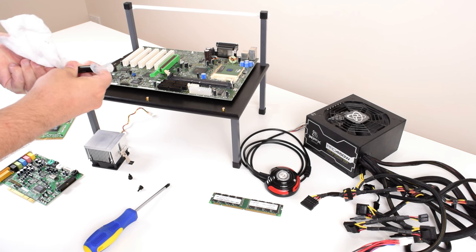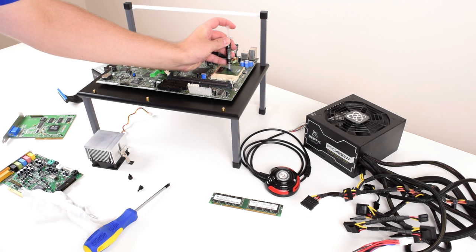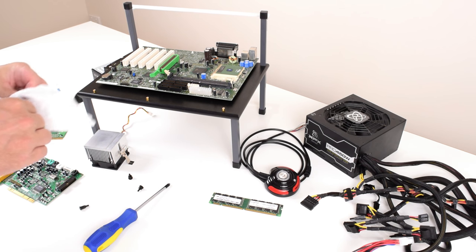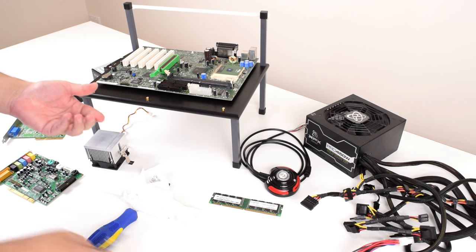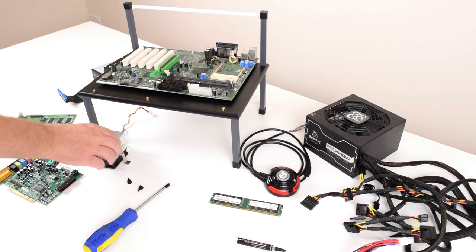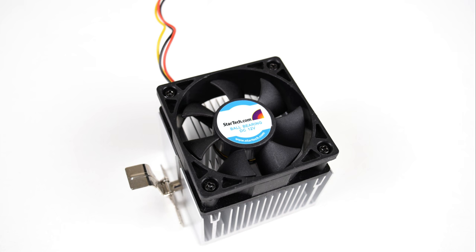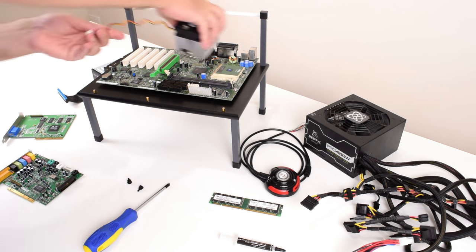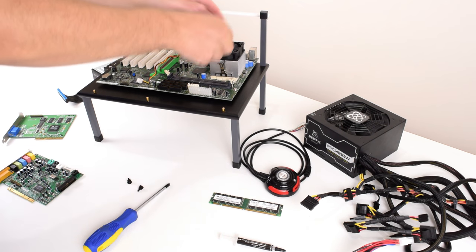The Voodoo and RIVA 128 both produce a very unique image. The Voodoo has a very soft and filtered image, doing a good job at hiding imperfections of early 3D games. The image looks quite good on a CRT monitor, but with modern displays it does look quite soft and blurry. The RIVA 128 is the opposite. It produces a very sharp and detailed image, sometimes too detailed, and with very little filtering going on, looking very similar to a software rendered image and with quite a bit of grain and noise in the image.